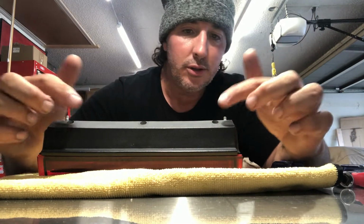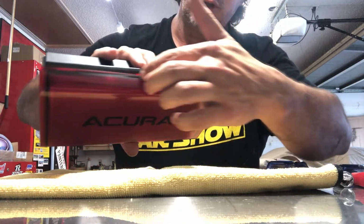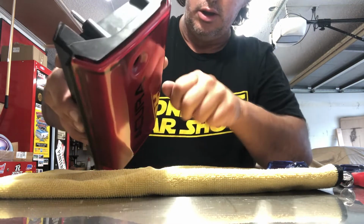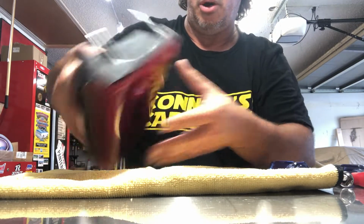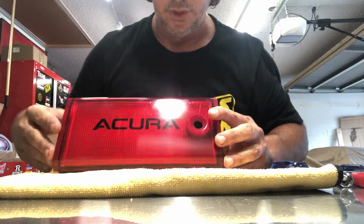So next step is to get these Phillips head screws out. Then we're going to heat around the edges here, and that's where the glue is holding this in. It should become really soft and allow you to kind of easily pry this up to get this apart. And then once that's done, you can scrape this sticker off from the inside. So let's get to it.